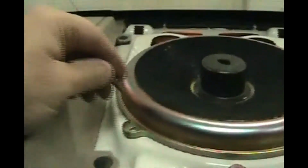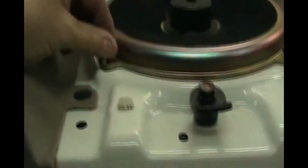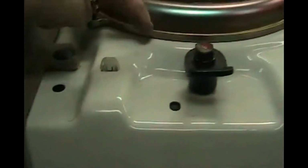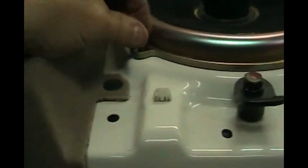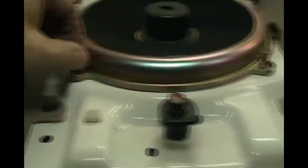Let's find that connector first. The connector is towards the front of the car, close to the back seat. So when you put this speaker in, make sure the connector is towards the front of the car. Okay, so we got the speaker in with the connector right about here, so it'll be able to be plugged in the trunk.